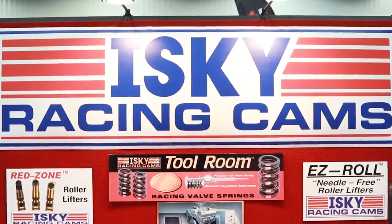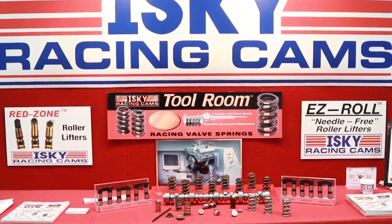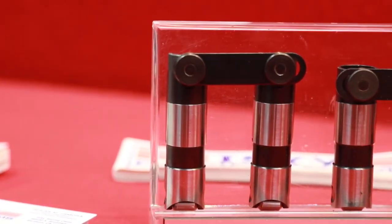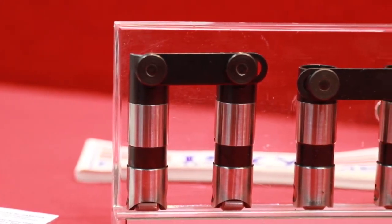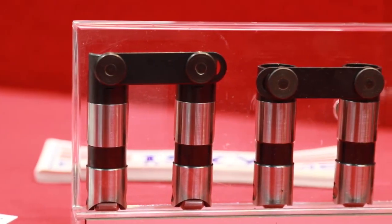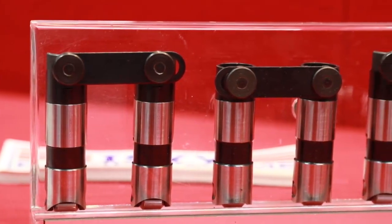Well, Nolan, going into that, let's talk about the specifics, because people want to know why it's going to work. Let's go through the mechanics of your new lifters. Okay, so the new lifters, we design the internals, and a lot of times the ones that you can buy off the shelf aren't engineered correctly, and so you get a lot of blow-by of oil, which allows it to squish. So at any kind of RPM or pressure, it squishes and you lose the cam lift and duration. So what cam you think you're running, you're really not running, you're losing that performance. So with our lifter, the pushrod stays at the right height, and not only that, it doesn't compress, it actually follows the profile.